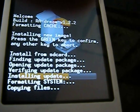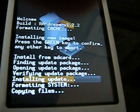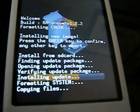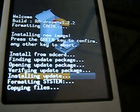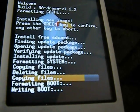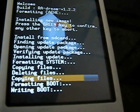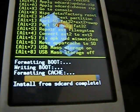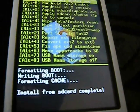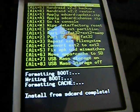I would advise if you decide you don't like this, you should make a Nandroid backup when you first flash it, which is on the recovery menu. Just click backup Nandroid, and it should make one, and then you click restore — it's at the very top — restore when you want your old version back.